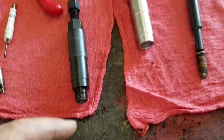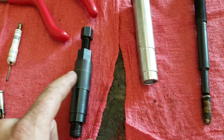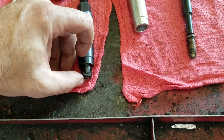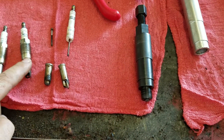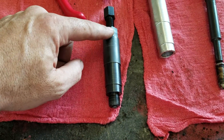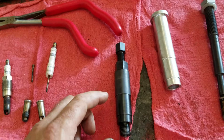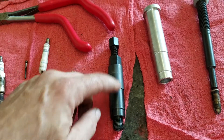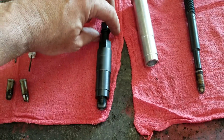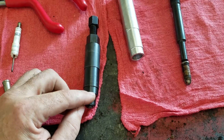The next step is to grab the porcelain pusher. After you get the electrode out, you get the porcelain pusher and back this thing out so that rod is sitting flush with the threads. These threads screw into the spark plug hole. Then when you screw that down, you're going to use a 21 millimeter socket to tighten it up. You don't need to go real tight — that's why you need your stubby ratchet, because you're only going to use wrist power. That's all you need, just wrist power. You put that into the spark plug hole and then take your 5/8 or 16 millimeter and start screwing that in. It's a right turn — everything here is righty tighty, lefty loosey.